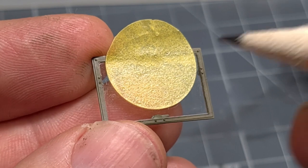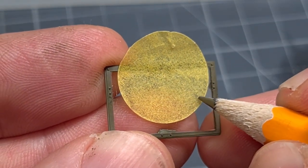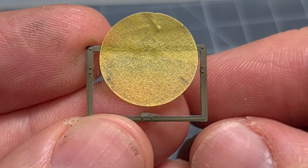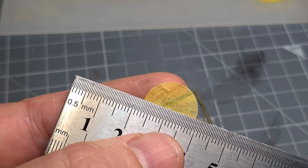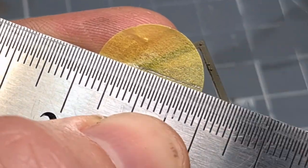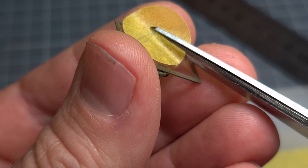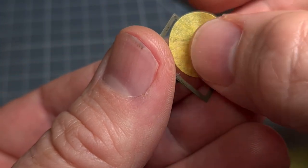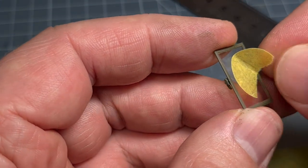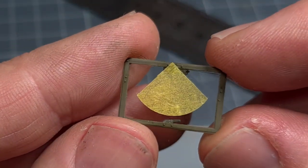The windscreen wiper won't go all the way around the windscreen, so we need to determine the pivot point and also where the wiper blades will stop. I use a pencil to just mark an approximate area for this. I then use a steel ruler and draw out the edges where I need to do some cutting. I now use a pair of sharp scissors to cut away the masking tape that we don't want to be part of the mask — don't peel away the entire disc so you don't lose the position that you've carefully marked out. There you go — this is now ready for spraying.